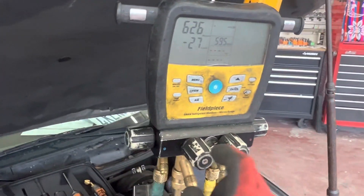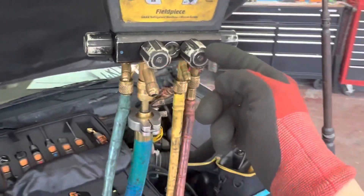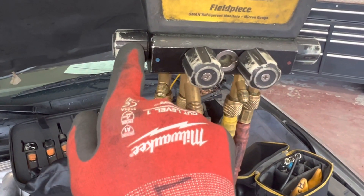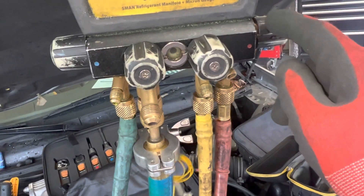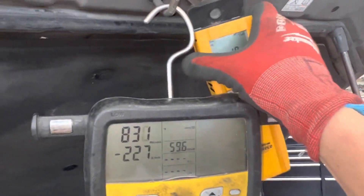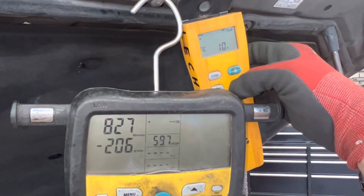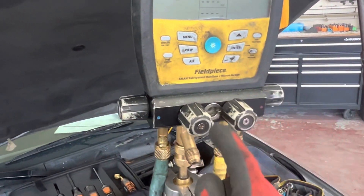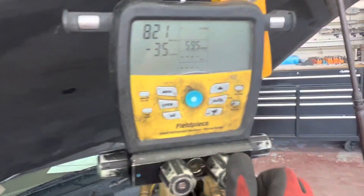Vacuum pump's on so I need to turn off the vacuum. The vacuum is off. So we're ready to inject the liquid as soon as I open up this valve, because the suction is off the low side. The high side pressure is open. 850 grams and we're going to get that from our wireless bluetooth scale that I already zeroed out. I'm going to skip the scale setup on this video because I'm trying to shortcut here a little bit.